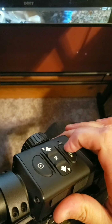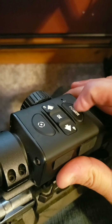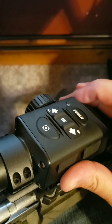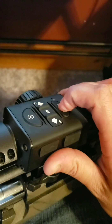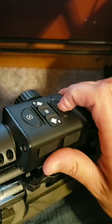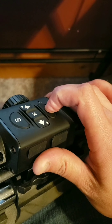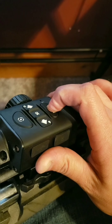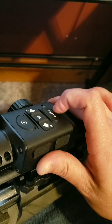The second thing you're going to do is hold down the power button. If the scope is off, as soon as you touch the power button it's going to click — do not let go. Hold that power button down until it clicks off. That guarantees there's no power in the scope. You're going to hold that down for up to 30 seconds sometimes. There's the first click, then the second click — that was about 20 seconds of holding the power button down. The scope is now off.